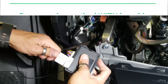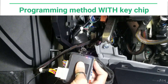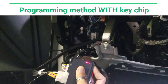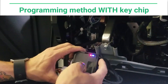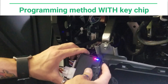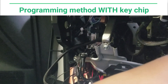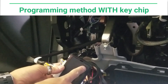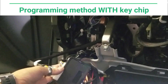For the chip method: hold the programming button and insert the large white connector into the front. The lights are going to cycle between colors. Release the button when the two outside lights are on — red and blue. You'll see blue, red, amber, red, blue — release — then hit the button two times. Put the key in the ignition and turn it on; do not start the vehicle. Wait for the red and blue lights to start blinking, then wait for the blue light to blink on its own — that means everything is programmed. Then you're done.